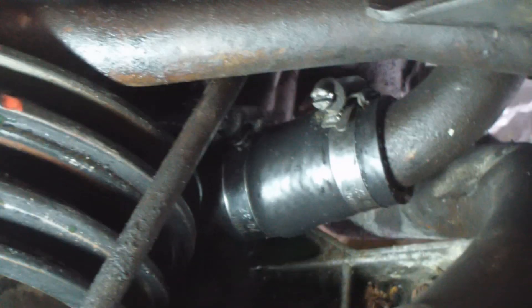The pulley and belt are back on. I'm going to put that top hose back in - all the big hoses are back on. Both coolant temp sensor wires have been reconnected. Tried to put the air conditioning back on - that's it, you'll have to bleed it yourself. I had one leak - that was the top pipe on the right-hand side. I put that back in and I just got done bleeding it. I think we're done.